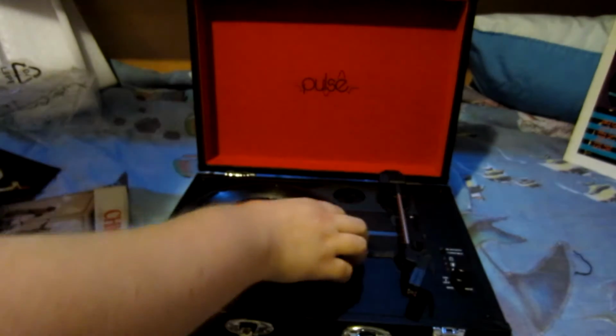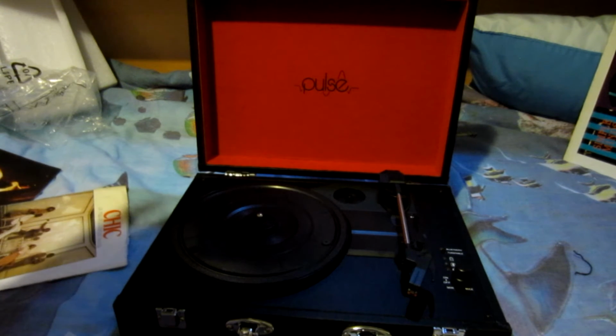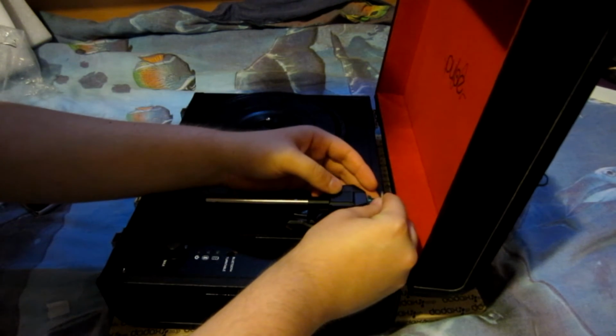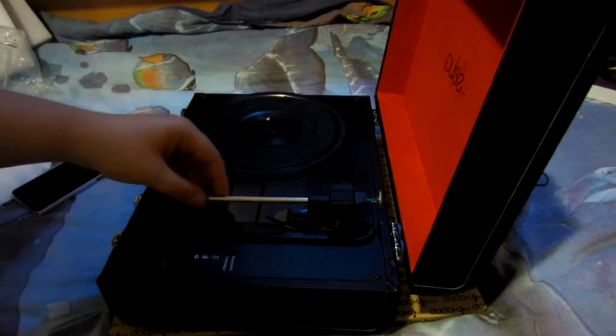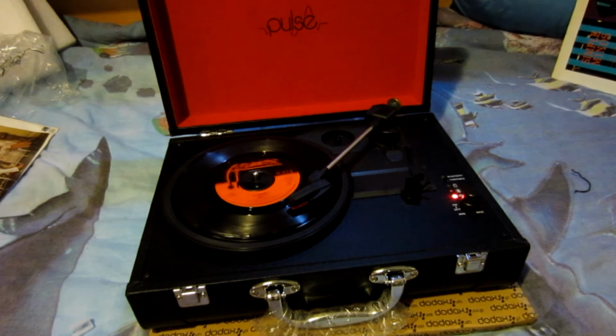And the record player doesn't really sound healthy to the record, so I quickly took it off and inspected the damage. This is what you usually have with those styluses for 78 RPM records and vinyls, because they simply don't work. I unfortunately didn't have a new stylus to try out, but I did try to give it a counterweight, because they don't normally have those. So I added 10 cents to the back of the tone arm, and with surprising result. It did play the record now without adding a scraping noise. Doesn't mean it's all perfect, but it is a little better than it was before.